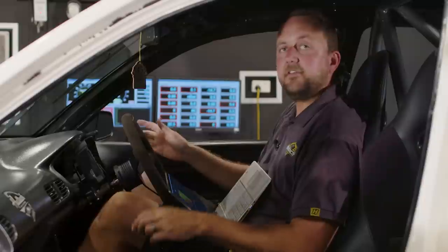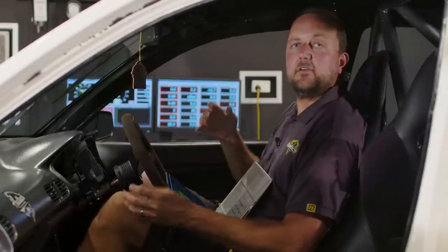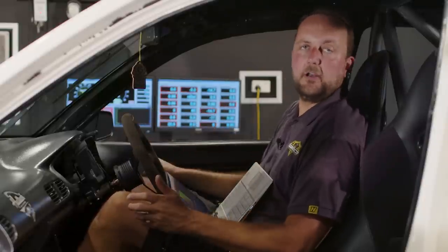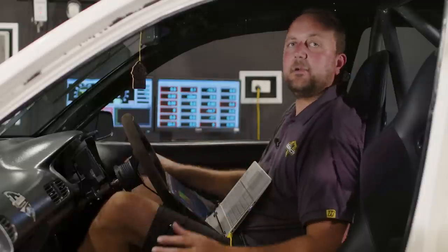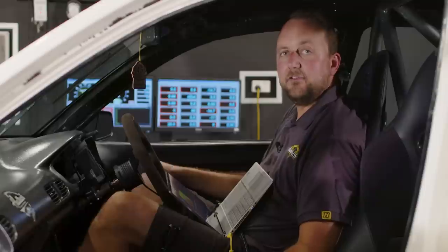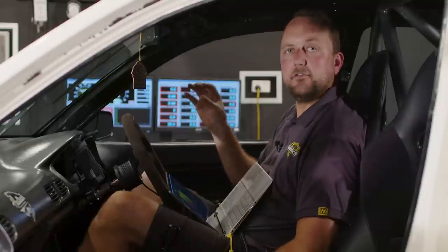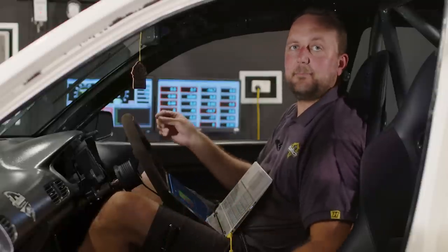So now, the first thing that we're going to need to do, I want to start the engine, I want to get it to idle and get an idea of how much vacuum it pulls at idle. Then I'll load it up a little bit and just get a bit of a feel for how much resolution we've got in the map sensor, and then we'll make a decision whether we need to tune the thing versus the drive-by-wire throttle angle, or whether we just tune it normally straight off a map sensor.